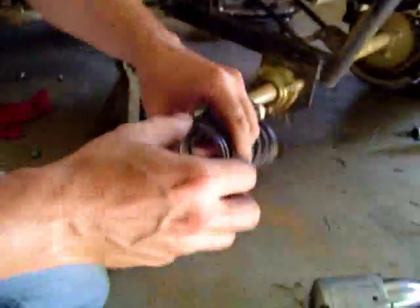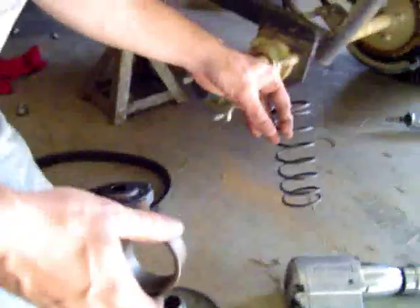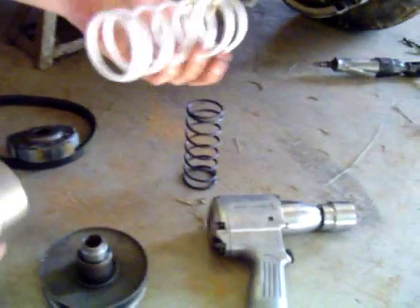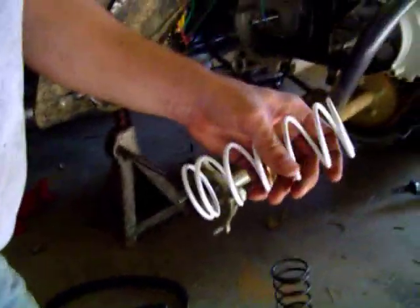In the spring, it's got a little retainer — pull that out like so. Set the old spring over here. Those are around 1000 RPMs. That main spring dictates when the buggy will start shifting into the higher speed ranges. We're going to put a little white spring on here — typically these are yellow but they come in different sizes. Make sure you check what it's rated at — this is a 1500 RPM spring.